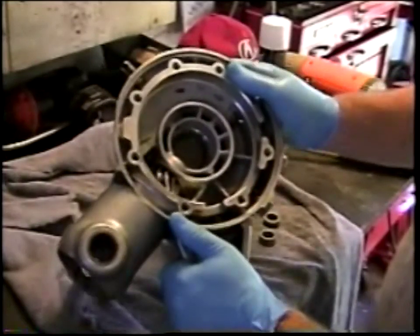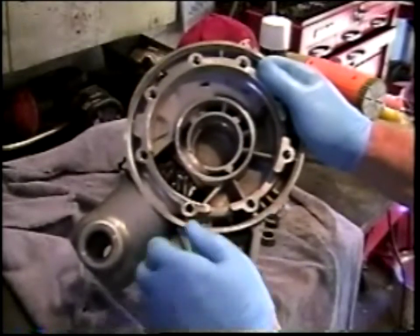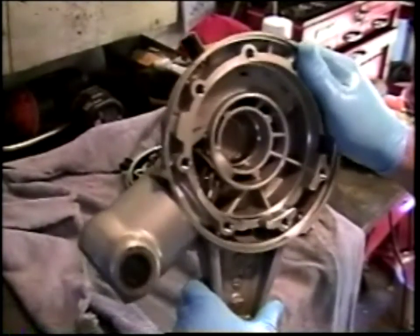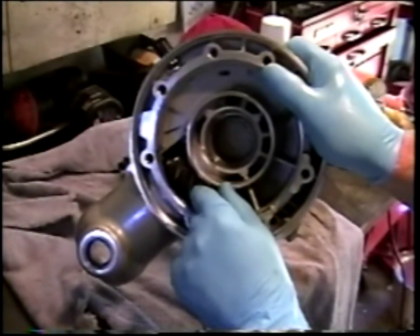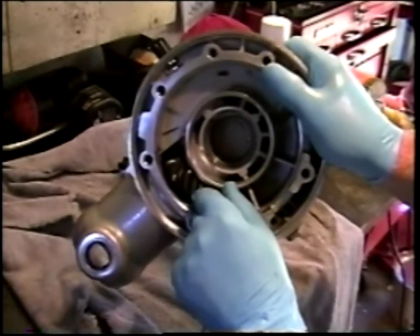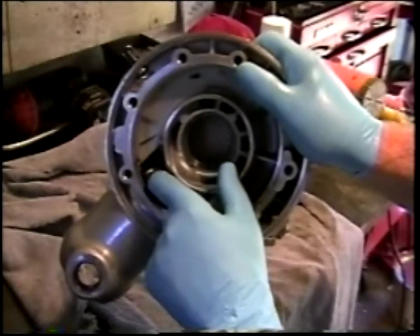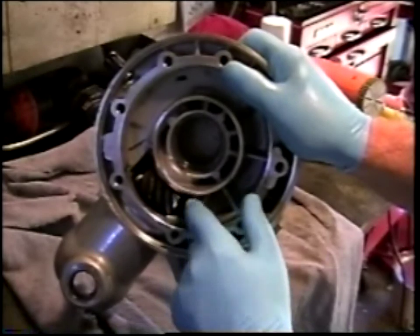The serviceability of the components of the drive housing are to look at the outer race of the tapered roller bearing to make sure that it's free of scoring or notching and that it's smooth and serviceable. Look at the teeth of the bevel gear. Make sure that the surface of the teeth are all free of chips or other defects. And make sure that the bearings of the input shaft and bevel gear are turning smooth and freely without any roughness.